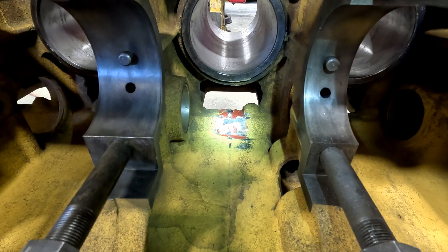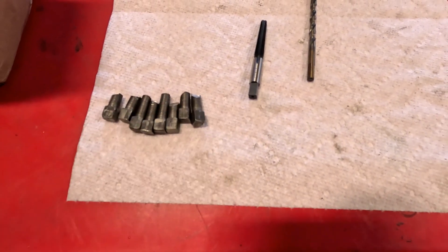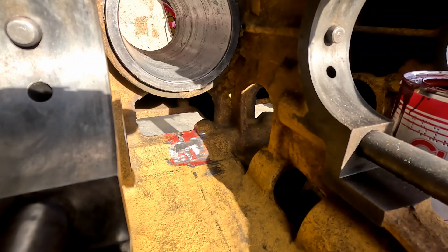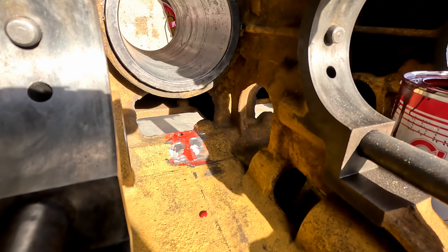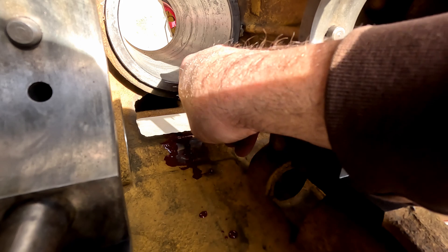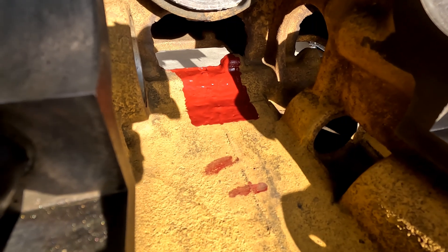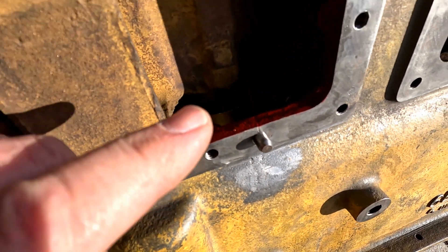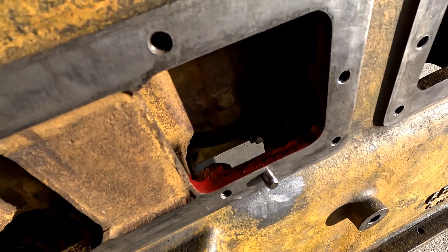Got those ground off and cleaned up — now we're ready for some Glyptol. We used about eight stitches on the block, and we're very happy with the results. I'm using some Q-tips to dab a little bit on there since I've already cleaned all this out and I don't want to ruin a paintbrush. That looks really good — that's going to seal up our stitch from the inside. I put a little Glyptol up on the top from the outside too, so any oil that might get up there will seal that crack and roll back inside the engine. We're going to call it done.